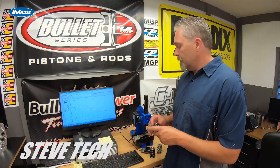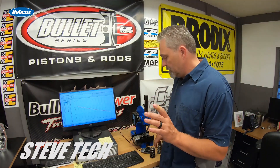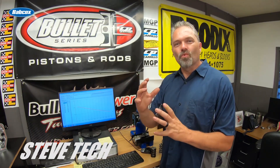In the NA world, pro stock guys really work on optimizing that. But remember on the valve spring: high-quality duals are always going to be better than triples because of frequency. You want to set these up properly — 50 thousandths to 100 thousandths maximum from your lift to coil bind. That way you're preventing spring surge and making things right.